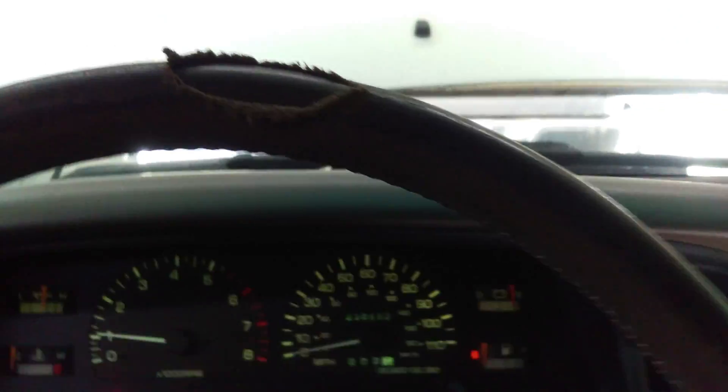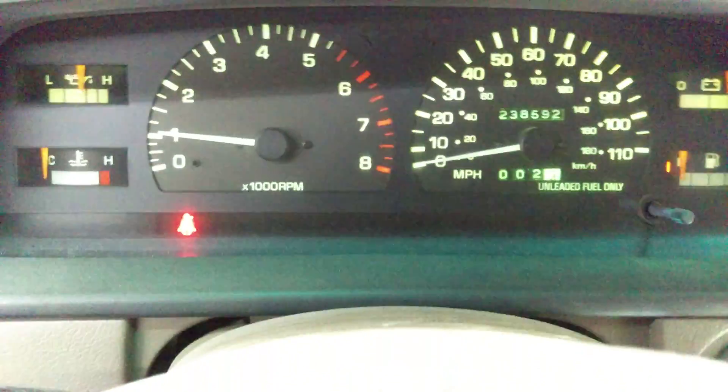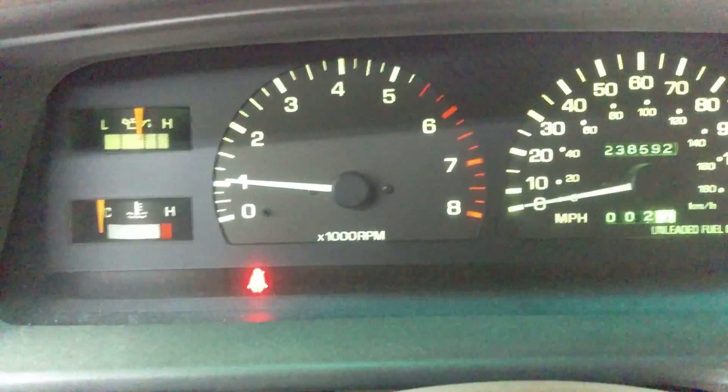There's our other side here. Everything's nice and coated. Idle's super smooth. It was high idle when it was cold, and as it warmed up it came down. So that tells me the idle controls are all working correctly.